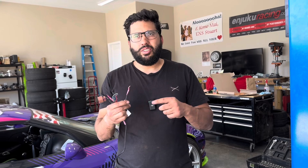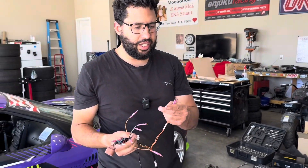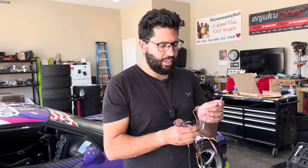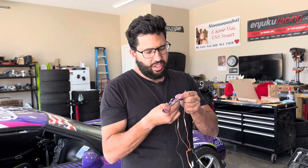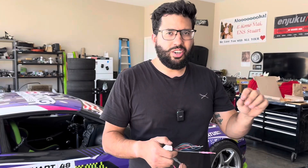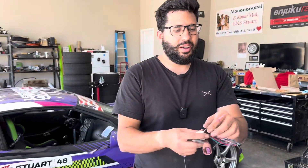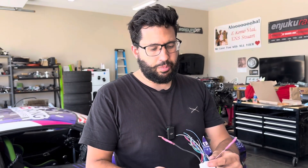Power wires are a blue wire and a black and orange. The ground wires are a green and red, and a yellow. The middle signal wires are black and white, and red and yellow. Put that together and you'll have a working pedal. The starter signal is through the key, all the way into that plug — from that plug I grab it and bring it to the starter. The starter has nothing to do with this harness; it is all in the chassis side. The pink wire from this harness goes to the pink and black wire which is your 12-volt switch source. All the other accessory stuff I'll maybe wire in the future, but not right now.